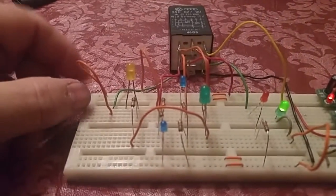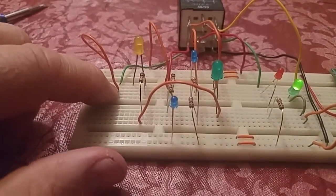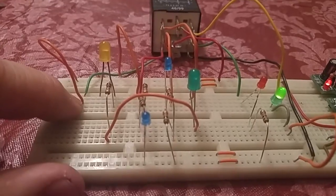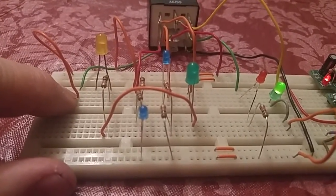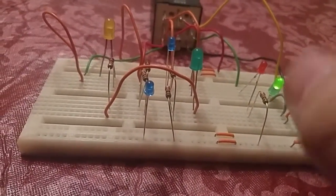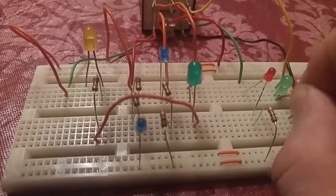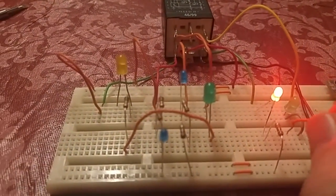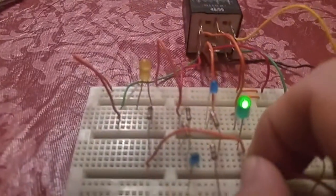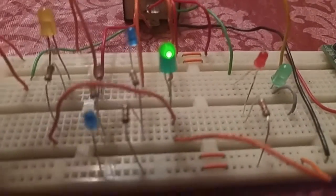Here is our shift wire. Right now it's applying 12 volts to pin 9, so it's not in drive. The park LED is currently on. I'm going to take it out of park and shift into reverse — there we go, our reverse light has come on. Now I'll put it back into neutral, and you can see the red backup light has gone out.